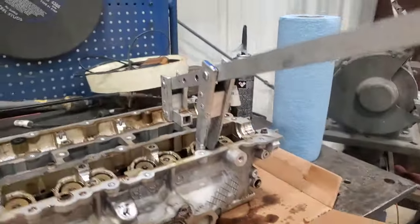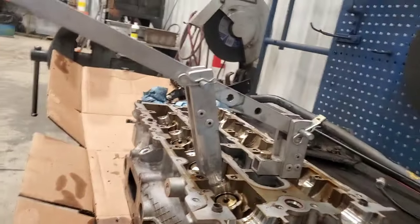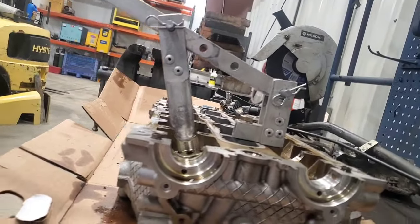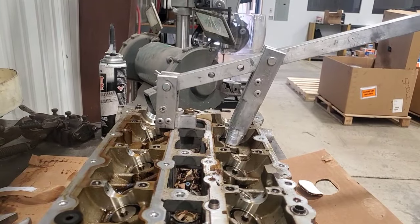Here's an overall look of the tool that was made to do this — a little bit of flat aluminum stock, some tube aluminum, a couple rivets and some clevis pins. The other holes there are for doing other types of valve retainer to depress them down to get the keepers out, but you'll get a look here at how this works.